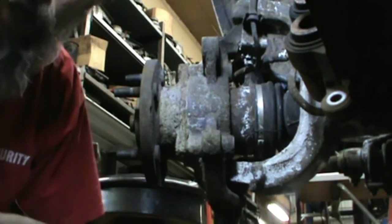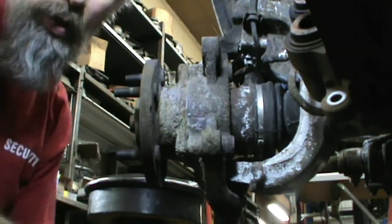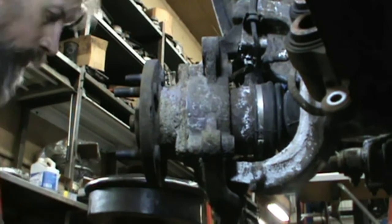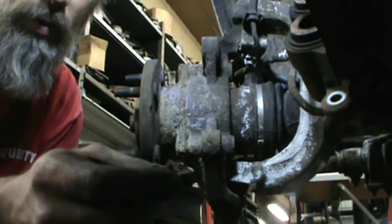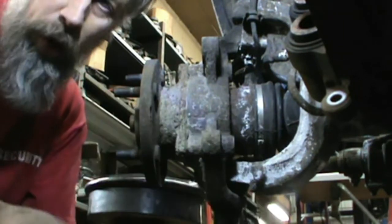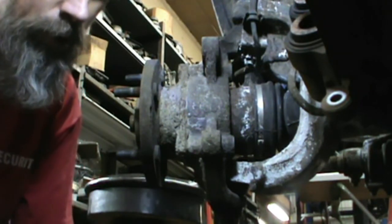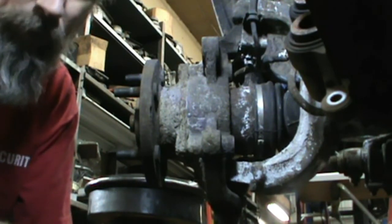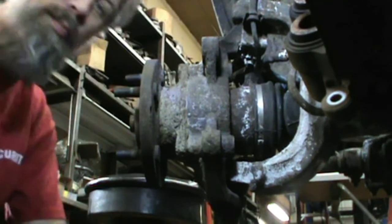On the axle side there's a nut on the front. There's a cotter key you have to pull out — mine didn't look so good, barely came out, luckily it didn't break. Then there's this little castle lock with a bunch of little teeth on it, and a little wafer spring washer that holds it tight so the cotter key doesn't move around. Here in Wisconsin they started using some new liquid salt that sticks to everything and rusts everything out, so I had to pry that one off. The axle nut on here takes a 36 millimeter socket.